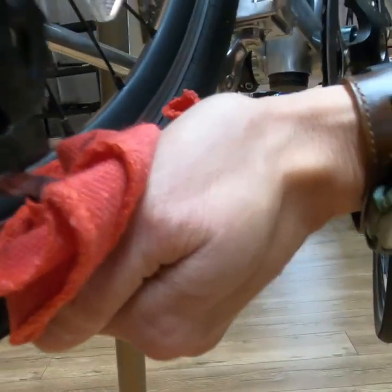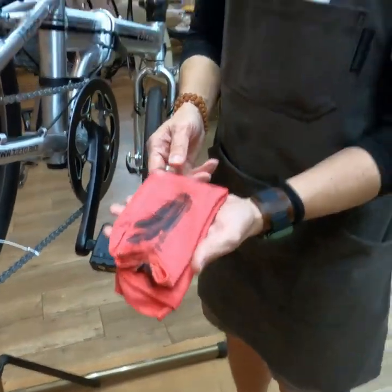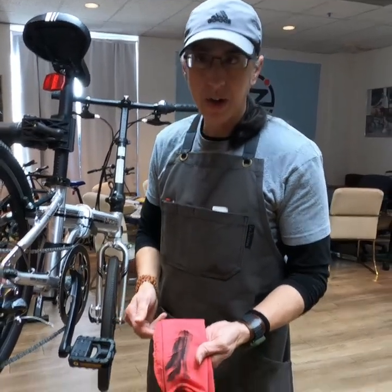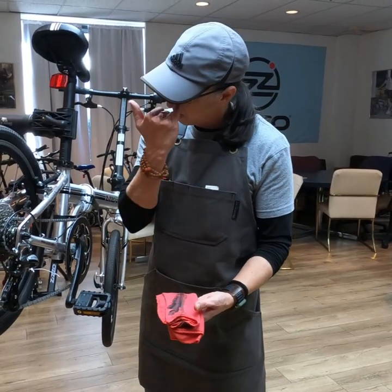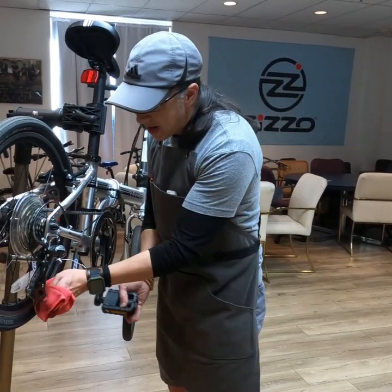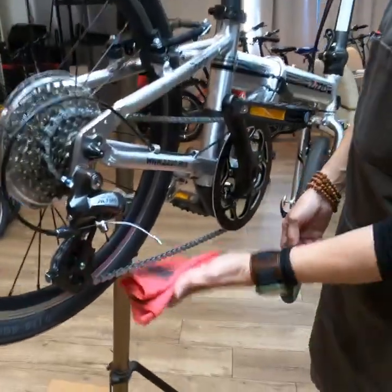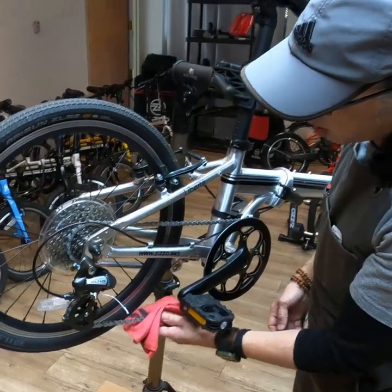What I'm doing here is two things: I'm sucking up that extra oil and I'm kind of cleaning the chain. Most lubricants we use on the chain are petroleum-based and they have a natural degreasing property. So applying that extra oil allows it to loosen up that greasy black tarry buildup, which you can actually see on the rag. On our showroom bike that doesn't get a lot of miles, I've cleaned up some of that black tarry buildup of old oil. And what I'm not doing is taking away oil from where it needs to be — inside the chain, between the two plates and in the pins.